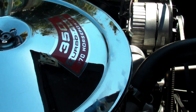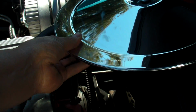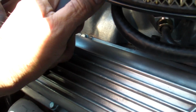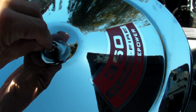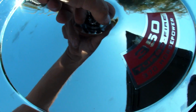These things are a little cranky, but not too bad. Get it running correctly. Flip the air cleaner back on. Make sure you get the PCV breather in. Make sure that your dimples are up front and properly seated there. Put your lid on. Get your custom Corvette Z28 Camaro Hypo Chevy chrome wing nut back on.